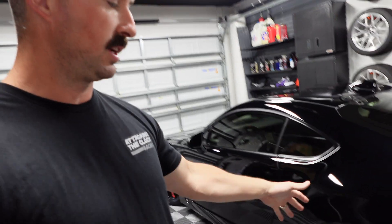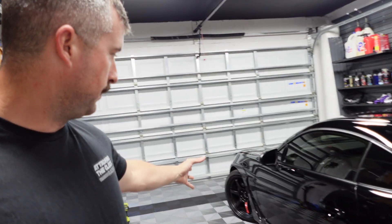This car sees a lot of track time. I run a super 200 tire — the RE71 — super sticky, 200 treadwear. Then we're also on Hoosiers, really really sticky. The bad thing is I'm on stock calipers and rotors with an upgraded pad. If you're just tracking a few times a year, put some Motul in it and a decent tire and you'll be fine. But with stickier tires and an aggressive pad, they're going to generate more and more heat, and with added downforce and mechanical grip, we need a fluid that can keep up.